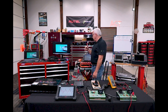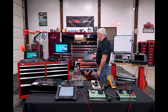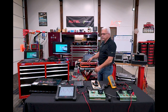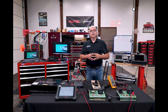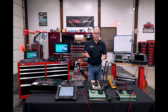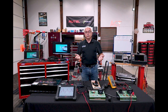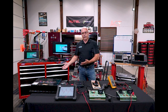I can diagnose a problem with the high-voltage battery pack as we can see on the scan tool here, but the problem with high-voltage battery diagnostics is what happens if I don't get that far. Let's say the complaint is that the vehicle will not accept the charge — that's frustrating because there are two different areas that could cause it: one could be the actual EVSE (electric vehicle service equipment), commonly called a charger, and the other could be a problem on the vehicle side.